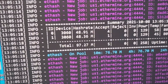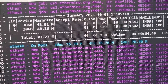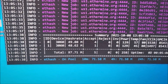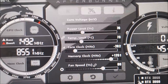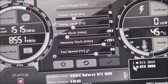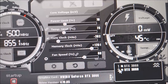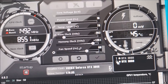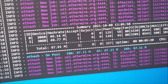Alright guys, I got them doing about 48.9 and the other one's at 48.3. I have them at basically 130 watts each — not too bad on efficiency. That one just clicked up to 49. Settings are: power at 76%, core at negative 202, memory at plus 1251, fans at 80%. Running 44-45 degrees Celsius. I might be able to push the memory a little more and pull the power back a bit, but for now I'm just making sure it's stable. We're showing 49.1 and 48.7.